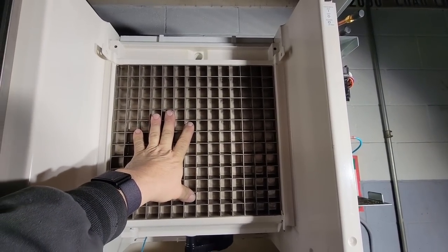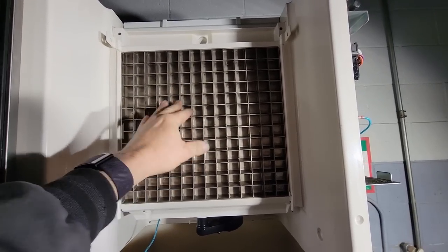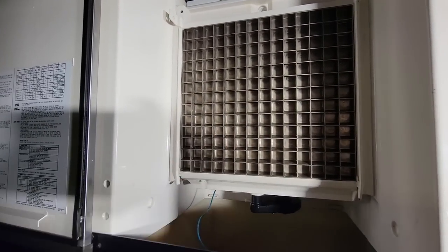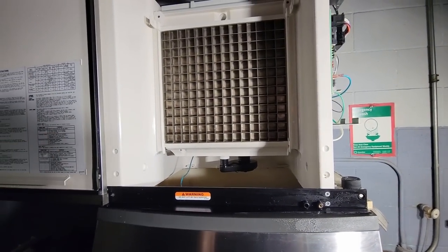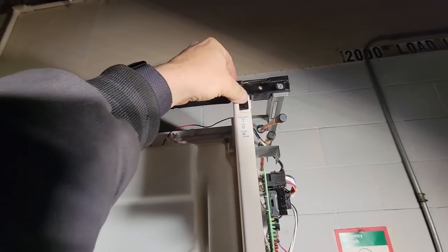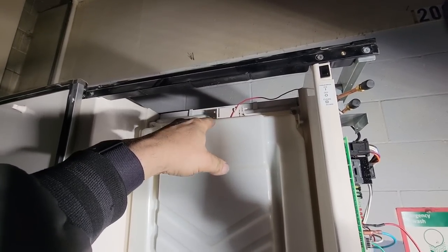When the plate has that scale on it — like sandpaper on paint — it's not going to let the ice fall off, which results in a long harvest. We've got all this cleaned up. Underneath looks pretty good; we don't have any heat contaminants in the air like in traditional kitchen areas. Let's get it back together and see what we get. Let's turn on ice. We did go ahead and blow out the sensors to make sure there's no water up in there.